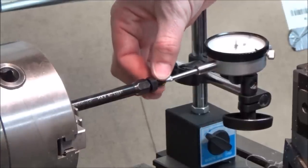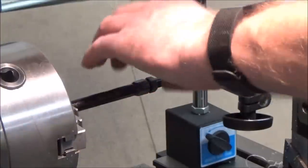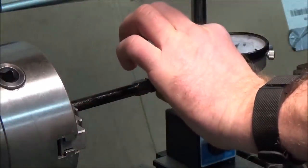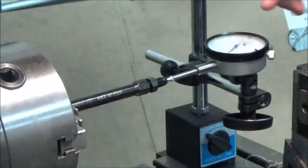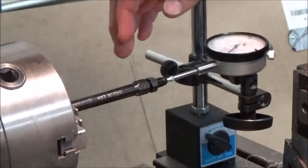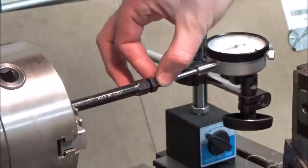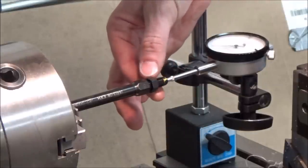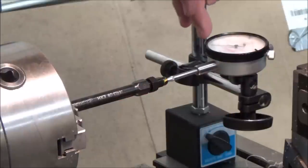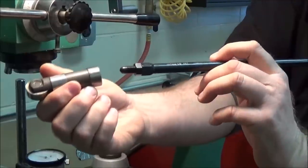Per the instructions with these pushrods it was two and a half turns, so we've got one — let's go ahead to two — and then I'll flip that around to the back side. We are about 82 thousandths, and we said that 100 thousandths is an estimate or rough number that a lot of engine builders use. It wouldn't surprise me if you found a racer who wants to put it dead set in the middle. At three turns this is just under 105 thousandths.